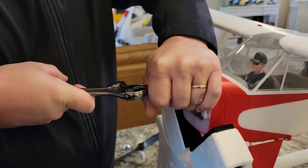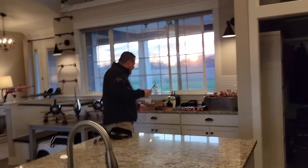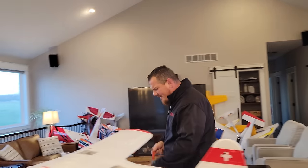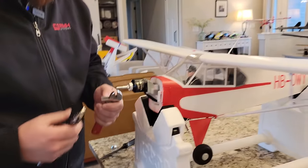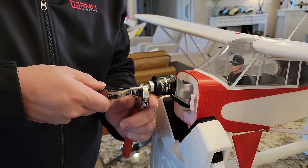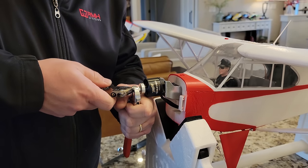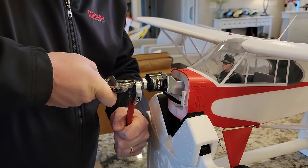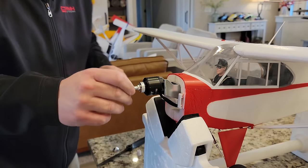I can hold the stator and protect it, then give it really good strength to bend the shaft just a little bit. You could also take this off and put it in a vise. Another trick: use a second crescent wrench — these shafts usually bend out at the tip, especially with this weird offset creating a lever. Spin it, hang on right here — don't mar your threads, it's just aluminum. I'm bracing with my index finger and thumb, going just past the threads to get leverage. You see what I just did there? I bent that. Now look — it's not perfect but it's pretty dang close.